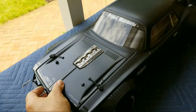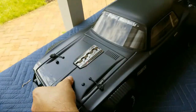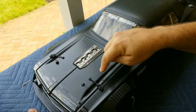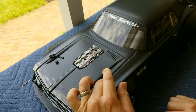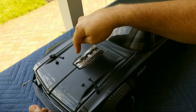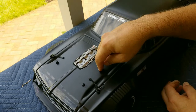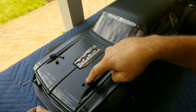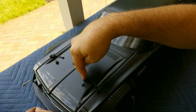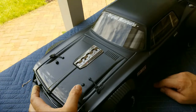So it just looks like rocking it back and forth kind of locates those pins. That's all I did, was just basically place it on, rocked it back and forth, and those pins got located. So something's holding that up. What's holding that up? Ah, the side skirt's holding it up. Yeah. So you see how that pin's not even popping through where this side is? So that pin's perfect. This one just needs a little touch down, and it's that side skirt hitting that panel.